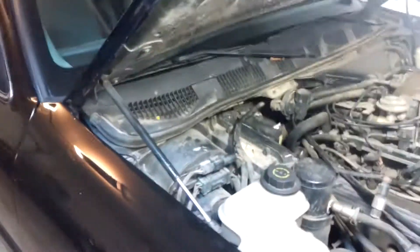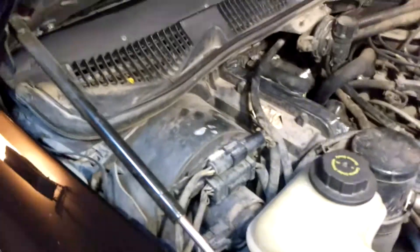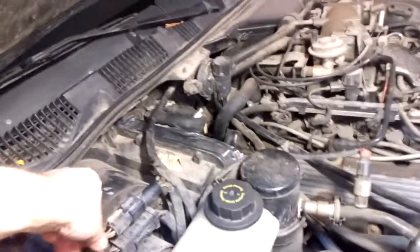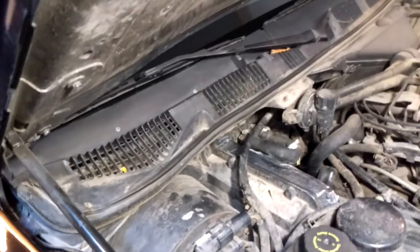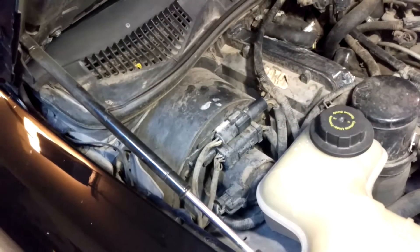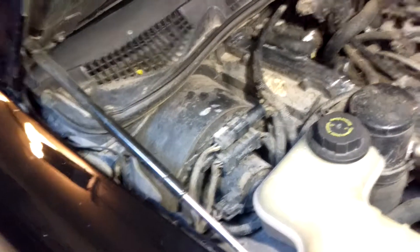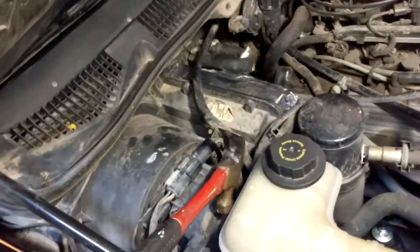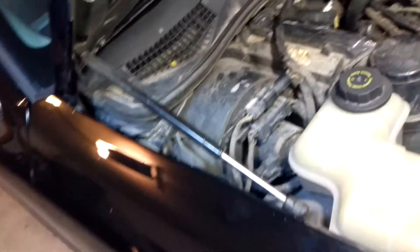There are a lot of different things to actually diagnose this — fuses, and I think some systems have resistors that are problematic — but I'm pretty sure it's the blower motor. I got some info from AllData, and I was also able to be around when it actually happened driving it home tonight. I did the old hammer test: it wouldn't turn on, so I knocked it right on the end and it started spinning again. Pretty sure it's a bad blower motor.